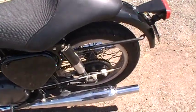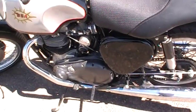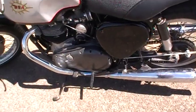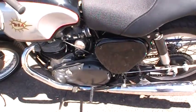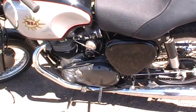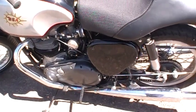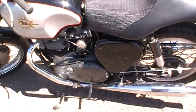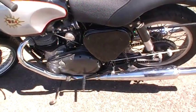I haven't got a chain guard on it yet. The primary is just a chain drive, but it has a three-spring Triumph clutch. If you're into these things, you know that's probably the best way to go — which is what the factory did right at the end anyway. It gives you something quite usable instead of having to fight your way through those six-spring things they put in.